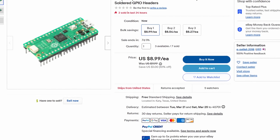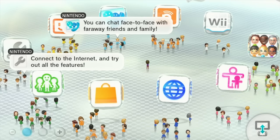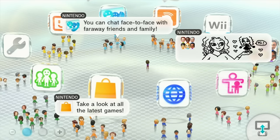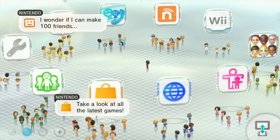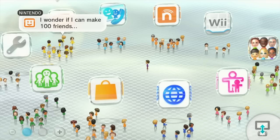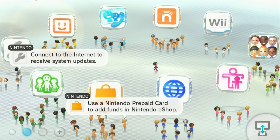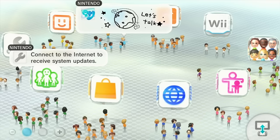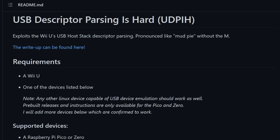They're only eight bucks — quite phenomenal. So we're going to talk about that and fix this system. Hopefully it's worth the eight-dollar investment to just try and see if this fixes your problem. What we're doing here is fixing the title ID that somehow gets corrupt in memory. That doesn't mean all of the memory is being corrupted in the NAND or EMMC — it just means something has happened: the system got the information mixed up about where it's supposed to point to in order to launch the OS menu.